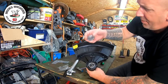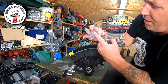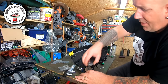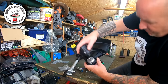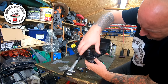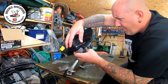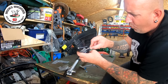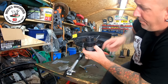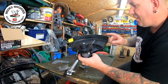You've got two collars — the bigger one goes on first, which is the thicker one, and then the second one sits on top. There are two tiny dowels and two grooves that locate and lock into place. You can then get your strimmer head attachment and screw that down — and remember it's an opposite thread. When you think it's on as tight as you can get it, use an allen key through the slot and turn it a bit more to make sure the head does not come off. If you don't do that, there's a risk the head could actually come off.